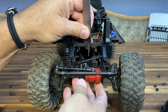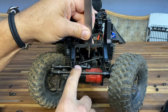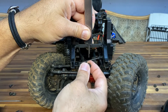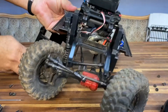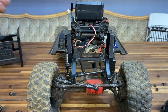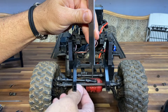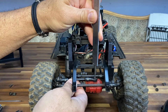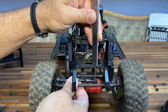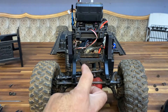Let's see if under full compression on the axle we actually have space before the link hits the bottom link — we don't want them to mangle each other. I'm going to take the stand off, place the car on its wheels, and compress the axle to see where the link would actually sit. That gives me just enough space to still be steering under full compression — the links are not mangling each other.